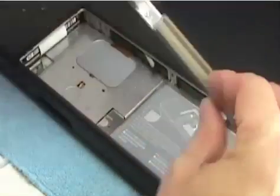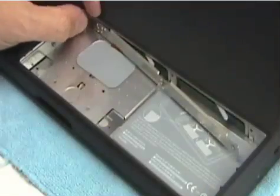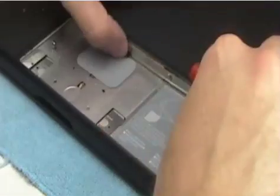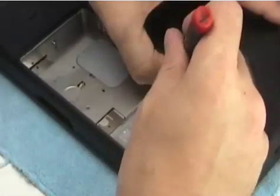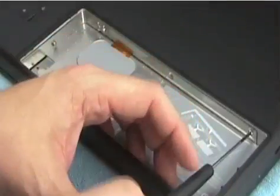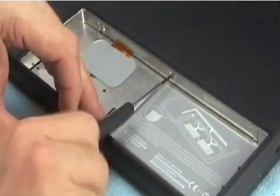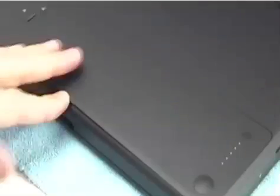Take the L-shaped bracket — as you'll notice, right at the end it has an EMI/RFI strip. These need to go down into the battery bay. Placing them in, I usually use the Phillips screwdriver to help close it and get them to tuck in all the way. Make sure they're in place before you try to put the screws in. Start with the end screw, then tighten those three Phillips screws. Insert the battery and using a coin, lock the battery in place. You're all set — that's all it takes to change memory or add a new hard drive to your MacBook.